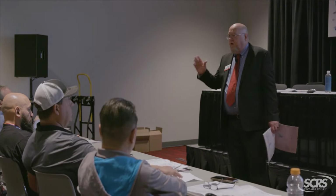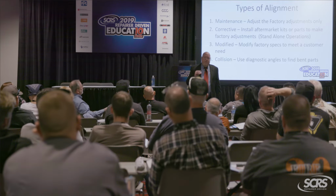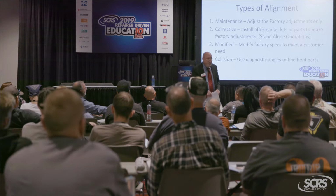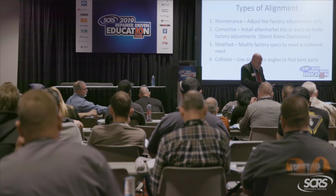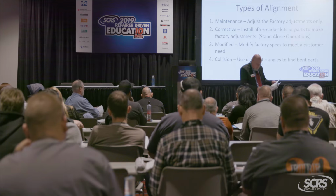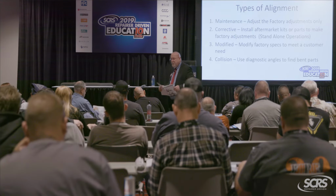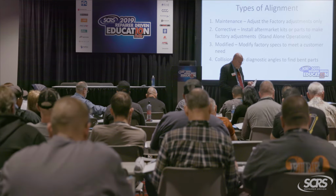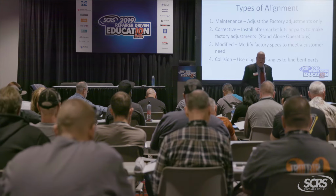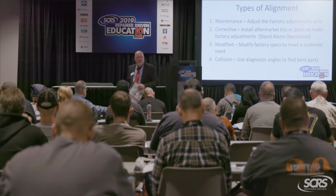Or you can even take pictures of this stuff and marry it to your electronic platforms. Our software is vehicle specific, all right? So in other words, as soon as you select the vehicle, like let's say a 2012 Toyota Prius, let's look at that one. What all do I need to do to that vehicle? That is on, let's see, bottom of page 68 in your adjustments book. What do we need for that 2012 Toyota Prius according to this book? Let's say I have a camber issue in the rear, camber issue in the front. What do I need, guys? Cam bolts and shims, all right?